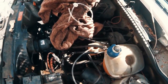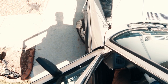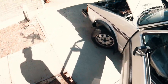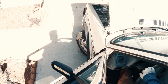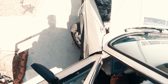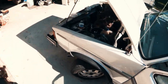Make sure that stays full. Start pumping your brakes with the ignition on. You see the fluid going in there? So it'll be a real soft pedal, which is fine — there's no pressure because your bleed valve is open. You can see it. Now the fluid is going back into the reservoir. Yeah, there's still plenty of fluid in there, so now it's a closed loop.